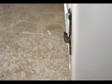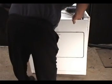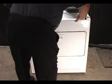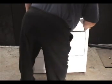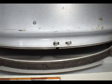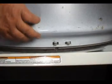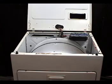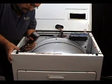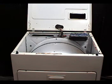When you install the front panel, first you have to hook it on the bottom hooks like this. Make sure that when you push in the front panel, the drum is going to ride on top of this felt like this. Screw in the front panel holding screws — the one on the left and the one on the right.